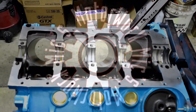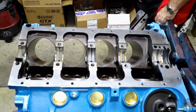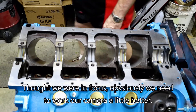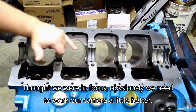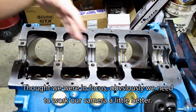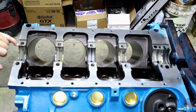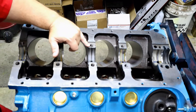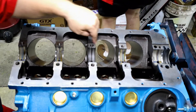It's now time to go ahead and check out and set in the crank. Unlike the cam, we are actually going to be setting the crank in place so that we can get our other measurements and make sure everything is cleared. We've already set the bearings in place here, just making sure these little notches are on the right and proper side, making sure they follow along here so that they don't spin out.